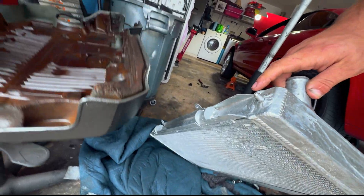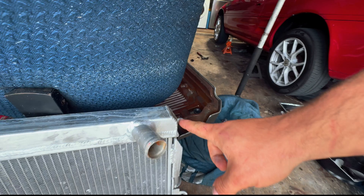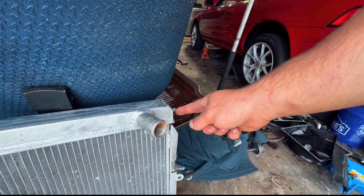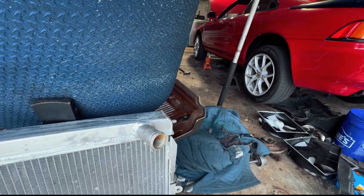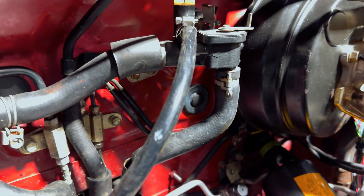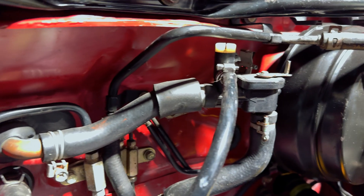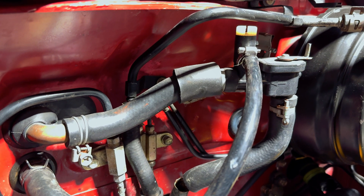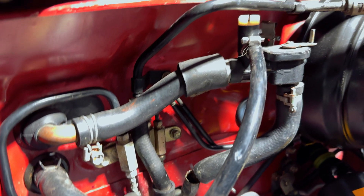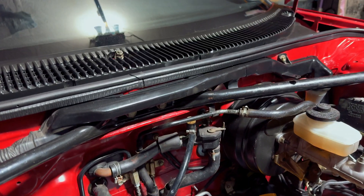I have NPT fittings that I'm just going to spin on here, put a little 90-degree fitting on that guy, and then it just comes straight out with the barb fitting right across, so I can just hook the silicone hose up to that. And as you saw earlier, this guy is pretty much all set up for the heater core whenever I do decide to get that hooked up. Unfortunately I don't have the hoses put in there just yet, because I want to get rid of the brass ones and just run the aluminum one that I've got on there now.